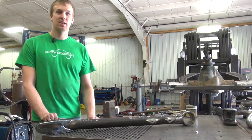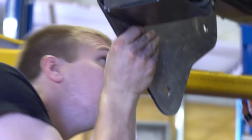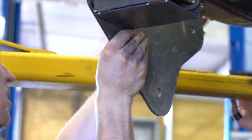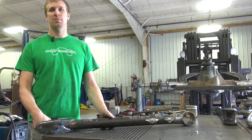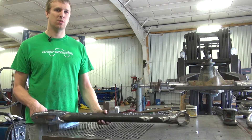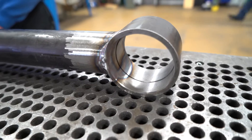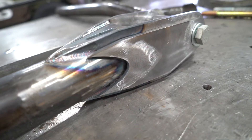The next thing we need to do is design the four-link brackets for the front suspension, trying to make them look as OEM as possible, as if it rolled off the assembly line this way. Going to a four-link setup because of better control of the front axle, better caster control, and better motion. Pretty beefy arms so they'll be able to take any pounding the truck takes.